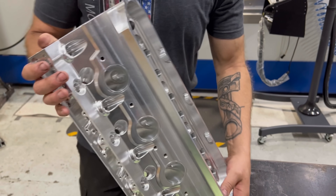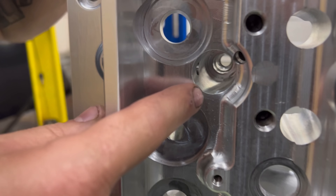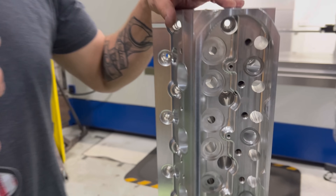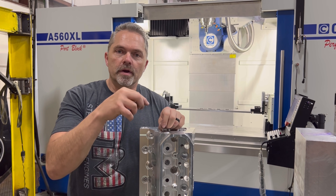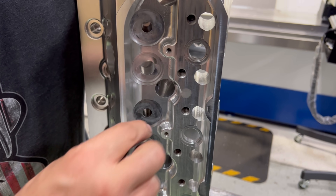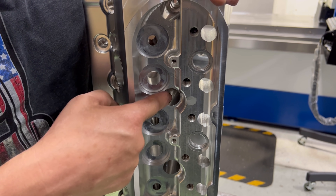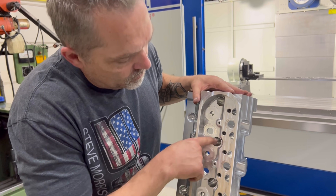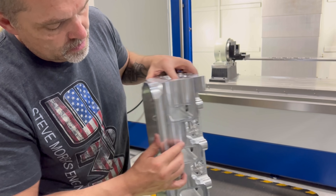There's a complete passage right here above the exhaust port cooling the top of the exhaust port. That passage then crosses over to this passage — this is actually a really cool deal we've come up with. One of our head studs has a billet o-ring barbell, like the one used for the oil pump on LS engines, that screws on top of the head stud after assembly. It's double o-ringed top and bottom, keeps the water in it, and allows this to become a water passage and a water heat sink.